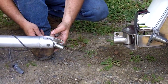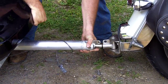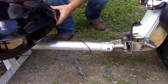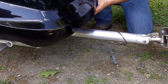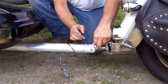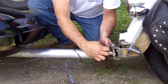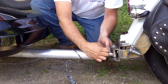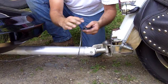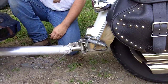So when you're ready to load, take your bolt out, pick the trailer forward, let the stand come off, insert it, and let the trailer lean over by pushing the kickstand up. As the trailer leans over, you can put your bolt in and then tighten the bolt up. Two three-quarter inch wrenches — and that is how quick you load or hook on your trailer to go. Put your four-pin receptacle inside and you are ready to go.